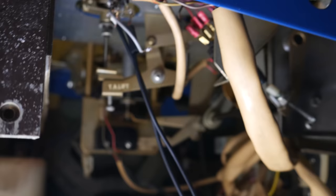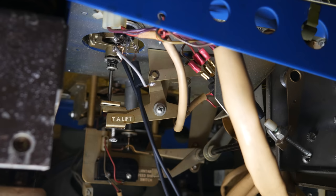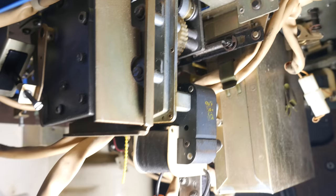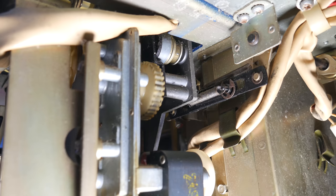So it's all mechanically programmed in this big circular thing so that as it makes a rotation, different things are getting pulled, pushed, tugged, and even more, as we will discuss shortly. But, and if it's not obvious, I inserted this later because I realized I didn't really explain the cams that much, keep in mind that this one motor is doing all those things we talked about. Just having a motor run pulls the record out of the carousel, puts it on the turntable, releases it, moves the tone arm, and it actually does some stuff that I haven't even talked about in this video, but that is all happening because this single motor is spinning.